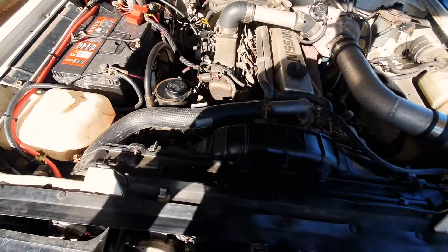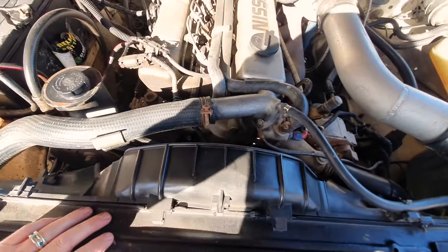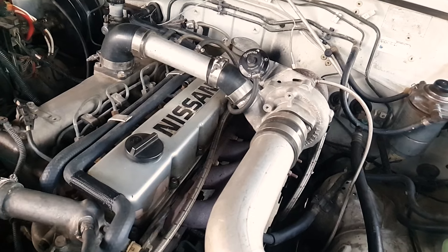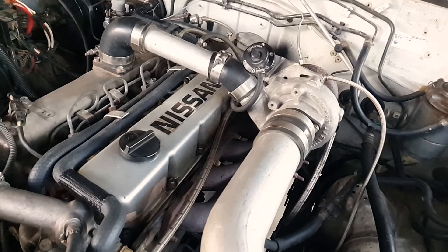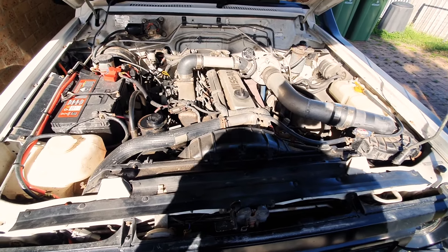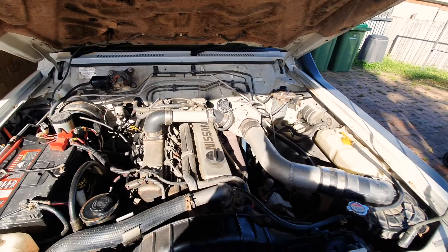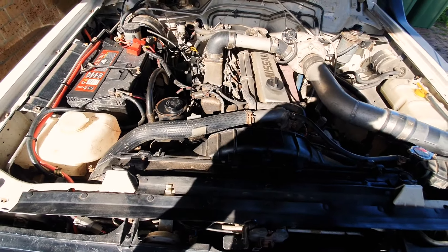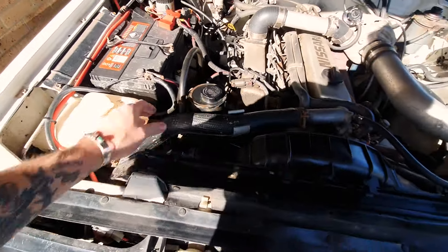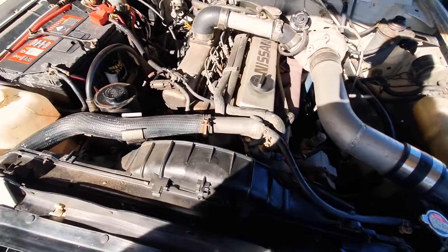The main things I'm actually doing this weekend is replacing all the coolant hoses and I'm also just going to chuck a thermostat in there. The old TD42s are known to get a little bit hot. I don't have any particular issues with this one aside from the occasional high EGT numbers on a big hill on the highway, but the old turbo doesn't help. So I figured I've never replaced these hoses personally, so I'd like to know when they were last done. At least I've got some spares I can chuck in the kit.